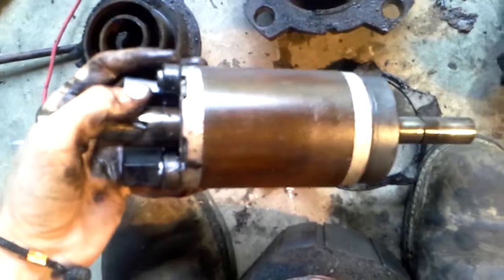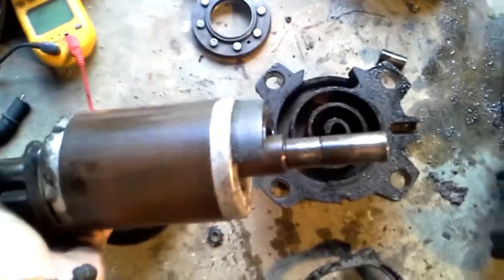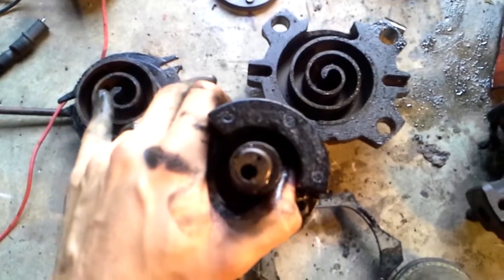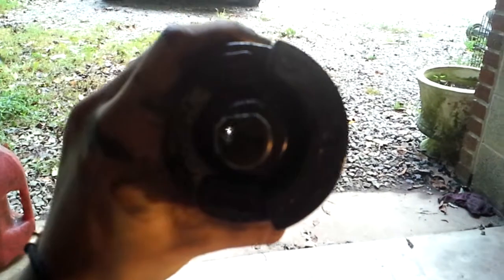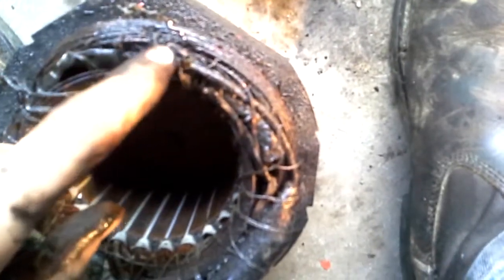There's your rotor that spins on the inside. What looks like plastic is actually an aluminum counterbalance — they're on the inside and opposing each other. That helps balance the motor whenever it's spinning, to compensate for the scroll oscillation so the unit doesn't vibrate. You can also see the oil passageway up through the crank where the oil comes up to lubricate everything.